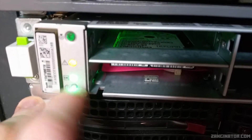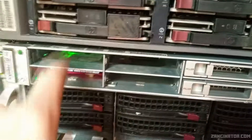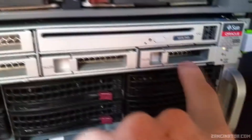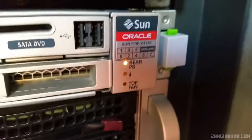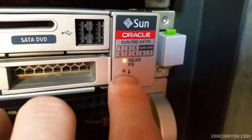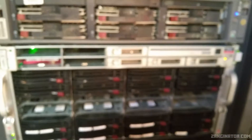There's a warning light that's currently lit up — I'll get to that in a second. There's a power light, the green one — it blinks once every 30 seconds when the system's off, once every second when it's booting, and solidly when it's on. On this side there is the drive map going 0 through 7, and some additional error-diagnosing LEDs. The warning light is on because only one of the power supplies is currently plugged in. If the system's overheating you'll get that LED; if one of the fans has failed you get that LED.